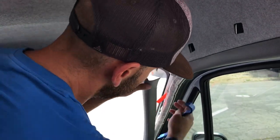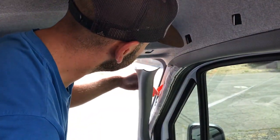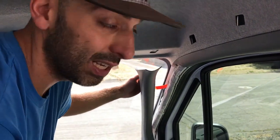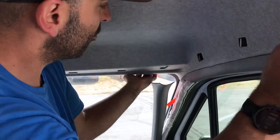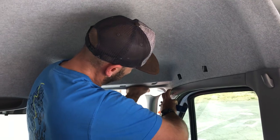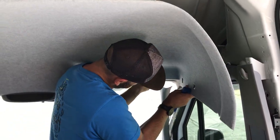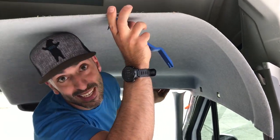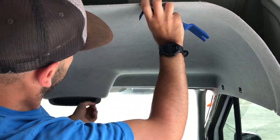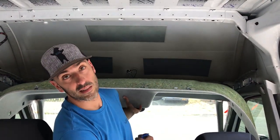Just remove that back a little bit — this is part of your airbag, so do be careful of that, don't touch it as much as you can. There's also a tag keeping this here — I believe that's to keep this piece from flying through the car when the airbag goes off. Once you get that out, it's just going to kind of pry from out from behind that as we keep sliding it back. Lift it up in front of that and it'll just fall right over that piece. It's pretty free at this point. We're going to have one electrical piece to unclip from the back where the dome light is.